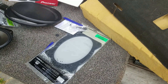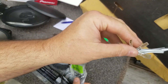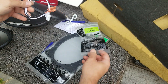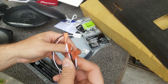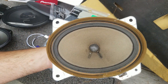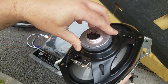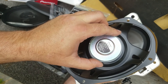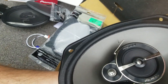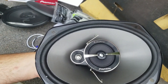I'm showing you the easy way because it's most likely the route most people will take. Here are your connectors that you could just use to tie into the speaker system in the car. But here are my adapters — these will plug onto the speaker and then plug into my factory plugs. I also have these adapter plates and filler strips, because if you look at this weird bolt pattern on the stock speaker versus the standard bolt pattern on a 6x9, they do not line up by any stretch of the imagination. You could drop the speaker in the hole and run some self-tappers, or push them up from underneath in the trunk with a nut and bolt. You don't need to buy this stuff if you're handy, but I have it so I'm going to use it.